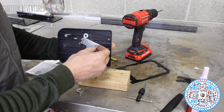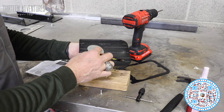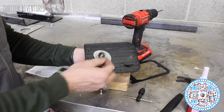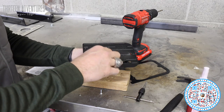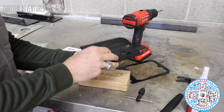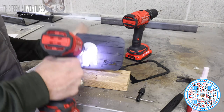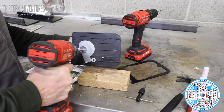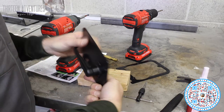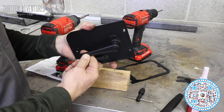Now I'm going to check my screw — it fits. So now you take the big washer and put it over that, then take the big open washer and put the small open washer over this one. Then put your screw in and tighten that down. Over time, if you've had an Airstream for a while and you pull on this handle, it gets wobbly right here.